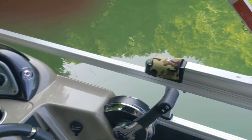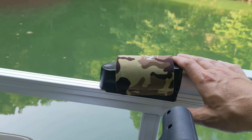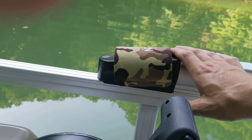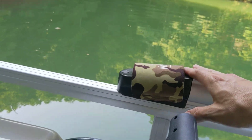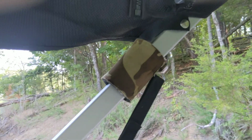So that's the three things for the Bimini that I've noticed. If your Bimini isn't going, first off, check the temperature of that. Make sure that it's cool enough, a good operating temp. If it's 100 degrees outside in the direct sun, mine wouldn't work. Yours may not either. Maybe that's something the factory will fix. Who knows? But check your power, check your fuse, check the temperature of this, and then go through and make sure you don't have any rattles over on that side. I know that's pretty big and obnoxious, but that's what it took. And then if all else fails, you've got the instruction kit up here in the actual top that has Allen wrenches, and you can fix it.